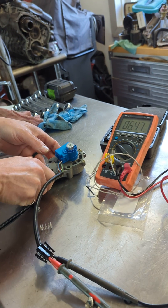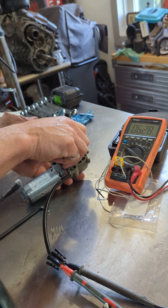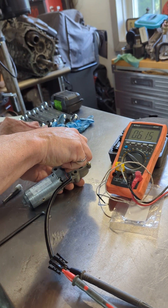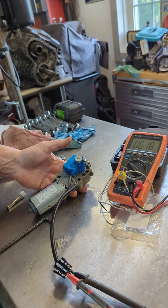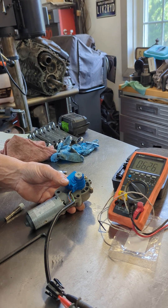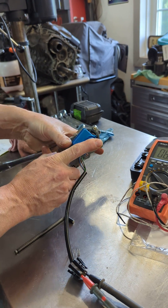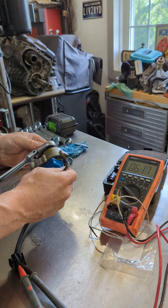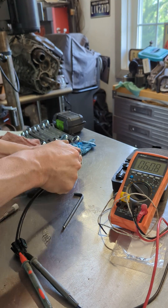I'm going to push in on this and dial it. I'm now at 6.26 and I want to be at 6.20, so I'll go one more notch — went a little too far, I'm at 6.16. Let me go one more notch the other way — 6.26. I'm pretty close. To get even closer, I can take this shaft off and dial it in really close. Remember, to take it off we turn it to the right as though tightening, which actually loosens it, and remove the pin completely.